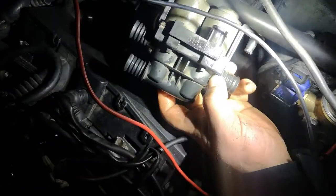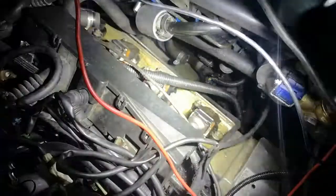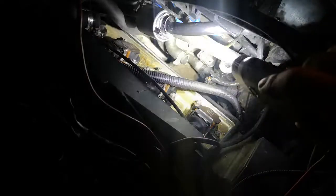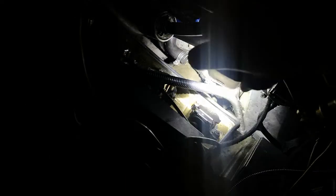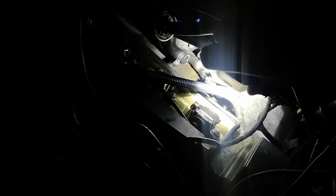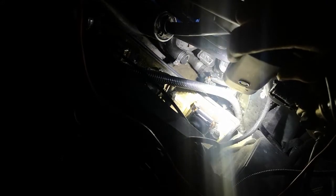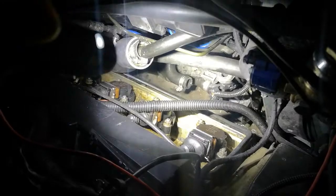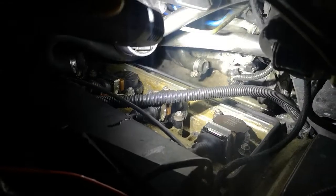So I had one pipe there, one pipe in at the bottom, two out. So once that's moved out of the way, you can see down there, right down the bottom, is that motor. Now it's held in a rubber bracket with an Allen key bolt, but I've found that you can just push it out of the rubber bracket without undoing it, which makes it a little bit easier. So let's see if I can light it up. Just down there, you can see one of the hoses going onto the end of it there.